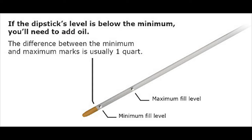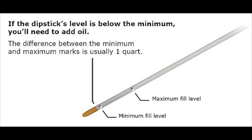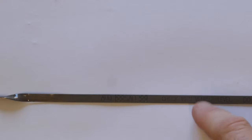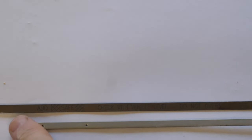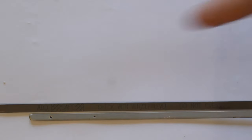Let's take a look at some real dipsticks in action so you understand better instead of just looking at a picture. Here is a dipstick out of one of my vehicles. You can see this one actually has an 'add' mark and some cross hatches showing you the safe level. The end that you insert says 'add,' meaning the oil is low. Above that there's a note to check while the vehicle is level. Here is a second dipstick — this one just has two dimples or dots, and they mean the same thing as the cross hatch. Anything below the bottom dot is not enough oil, and anything above the top dot is too much oil.